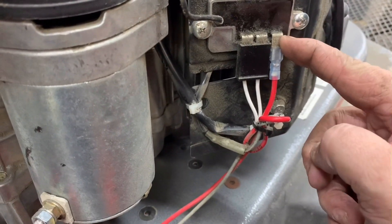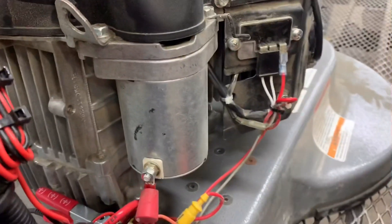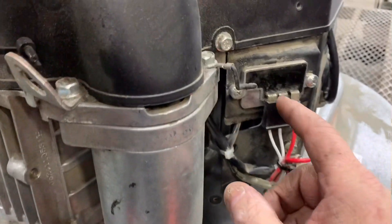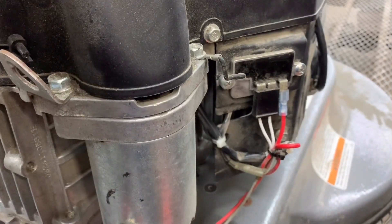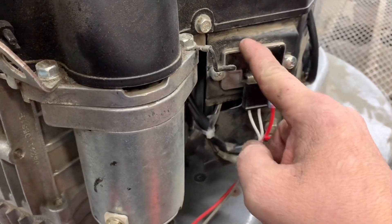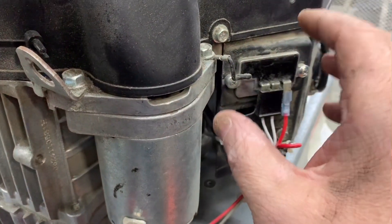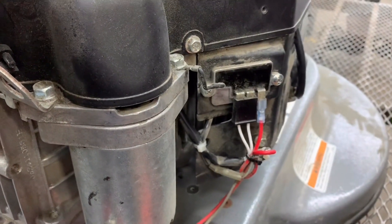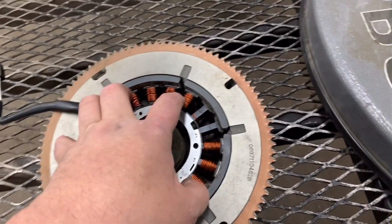When you're getting your 40 volts AC here but nothing out of this terminal, then you know your voltage regulator is bad. I have a video from the past — I'll put a link in the description below — where I actually have a tester for a voltage regulator. That tester is from Kohler but it'll test Kawasaki and Briggs too. It puts a load on it and isolates the machine — it just takes the guesswork out of trying to diagnose a voltage regulator.